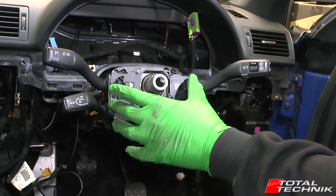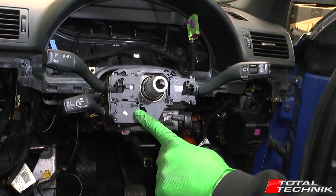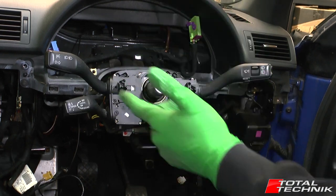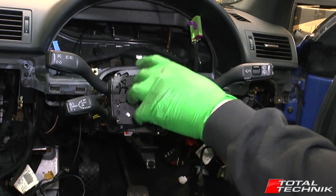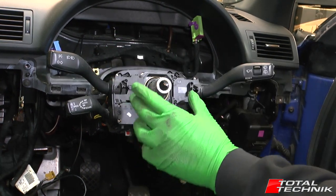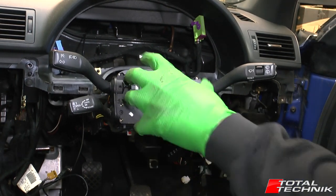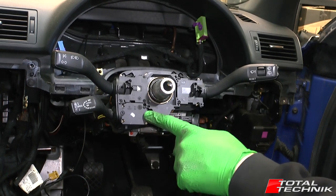As we can see, you've got a little bit of stripped-down work to do to actually gain access to the cruise control stalk. First of all you need to remove your airbag, then your steering wheel, and once your steering wheel is out of the way you've got your upper and lower steering wheel cowls, and then your clock spring that sits in the centre also has to be removed. Once you've removed those five things, then you've got the access that you need.